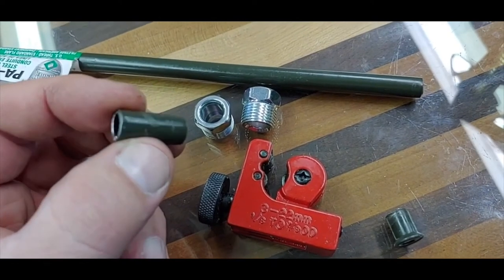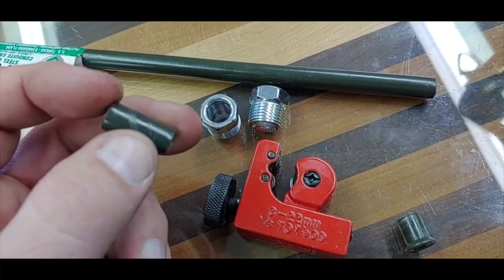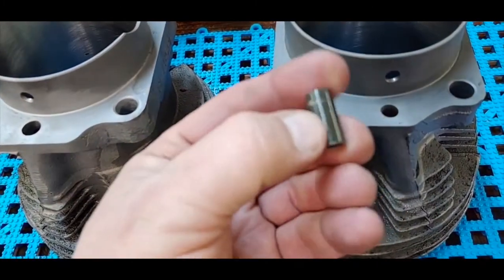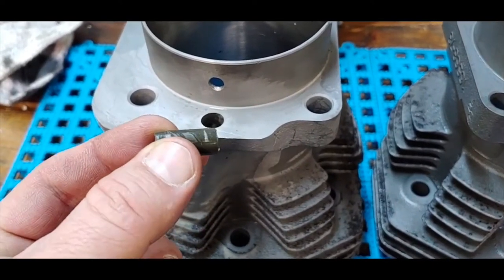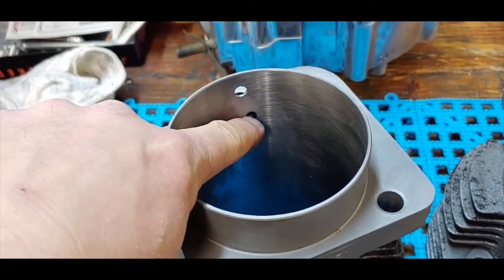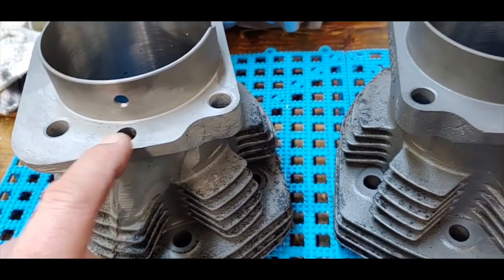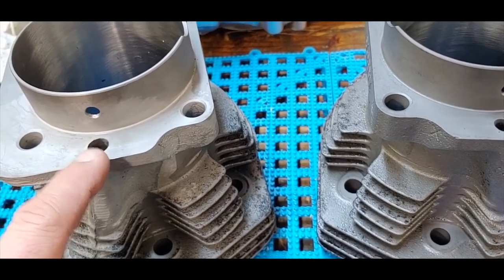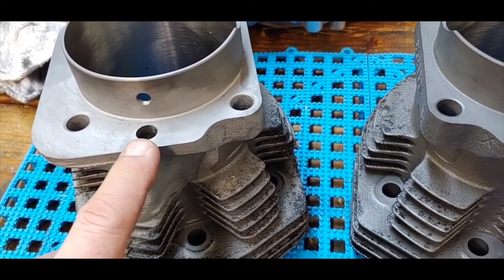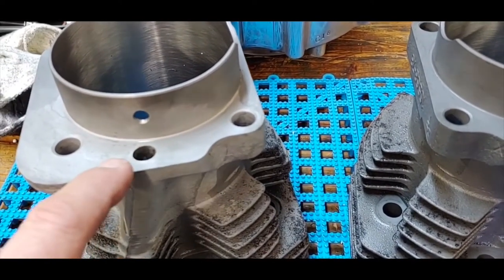What I made here is a piece of brake line, cut three-quarters of an inch long. I'm going to press this insert into the oil return hole in the cylinder to block off the original oil return hole. These are secured with Loctite. The best way to open the hole up is with a reamer — if you drill it out you get an interrupted cut because of the other hole inside. The insert has to sit below the gasket surface, just a little bit below.